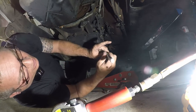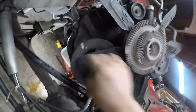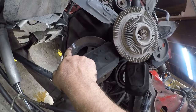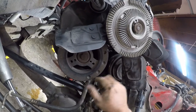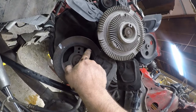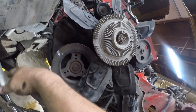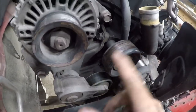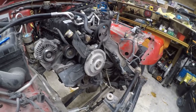I'm going to stop and regroup before the next step. I painted a mark on the harmonic balancer with nail polish so I could tell where I was and just rotated 25 degrees. This harmonic balancer — I don't like seeing cracks in the rubber like this, it tells me the rubber is shot. I might replace this when I have the engine out. I'm definitely pulling the oil pan and planning on replacing the oil pump. I've also got grooves in my pulleys so I'm probably going to replace those too.